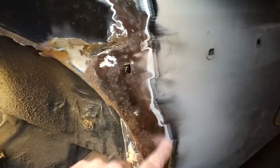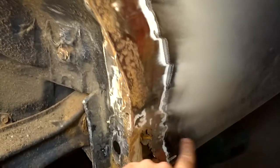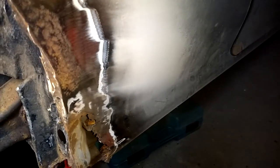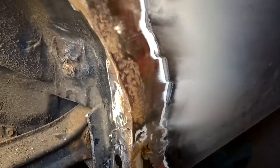I was expecting a lot worse. It's still going to be a challenge to rebuild this bit. I have got a panel — I think it's for this side anyway, I know I've only got one side. So I'm going to have to take some very careful measurements. Because this is the original panel, I'm going to take measurements off this and try and duplicate it on the other side, with the minimum amount of removal. It will be very difficult to blend in a large panel — this is a whole different league for me, doing this sort of body repair.